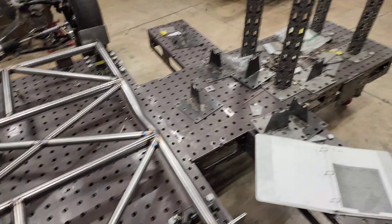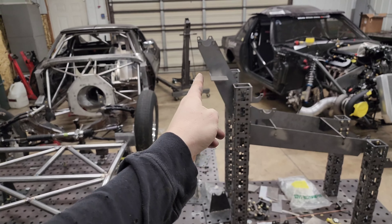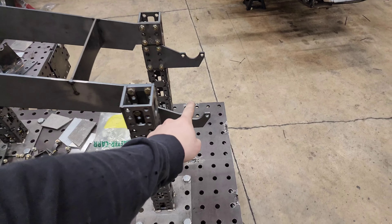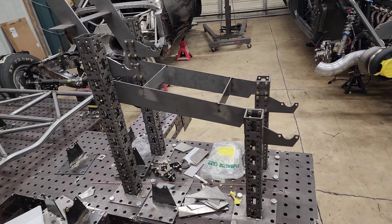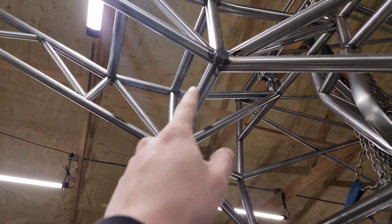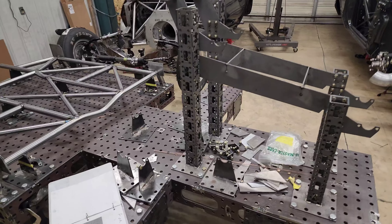This is the section for the back half. As you get the main hoop, the back half steps comes down — this sets our upper tube, this sets our shock bar, and then this sets the very rearmost tube. We get those set in first and then go build everything else around it. That first upper one, that's the shock bar, and then that there is the very rearmost one.